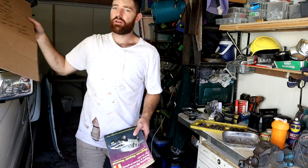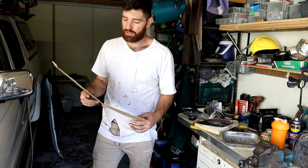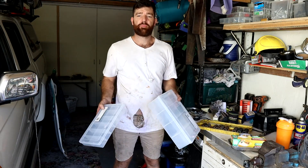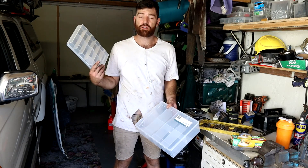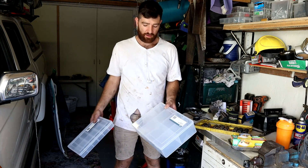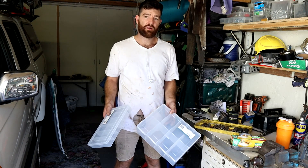I've just got a piece of cardboard on the windshield to keep a permanent marker handy, and I'm just going to write down things that I notice that need fixing. Hopefully by the end of it the car will be tip-top. It doesn't hurt to get some tubs to keep your bolts organized, especially for camshafts, valves, valve springs, pistons, and main bearings. You need to put things back exactly as they were - I mean exactly - so you've got to keep things organized.